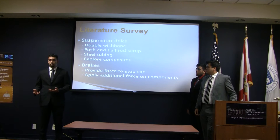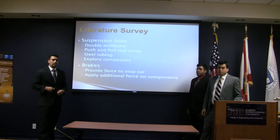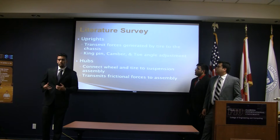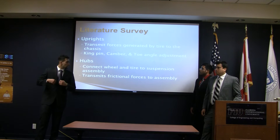Why are we talking about brakes? Brakes apply the force necessary to stop the car, but that force is also applied throughout the suspension and then to the chassis. So it is the suspension's job to absorb a lot of that force in order to enable good handling. The job of the uprights is to transmit the load from the wheel and wheel hub assembly through the A-arms to the chassis.